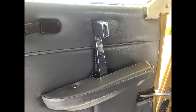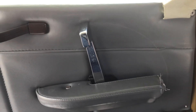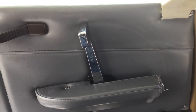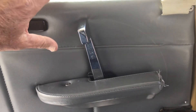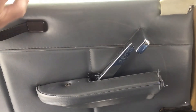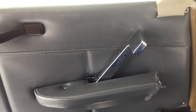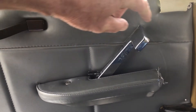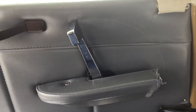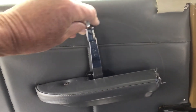In this next video, you will see the mark along the upholstery where the handle is rubbing. This is true for both doors, although the passenger door is not as bad as the pilot's door. The rubbing of the upholstery is causing the handle to not go to center and close properly.